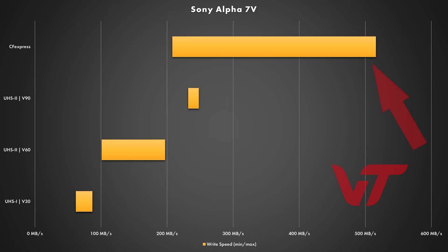The image buffer lasts really long with JPEG, but it can still get limited. We're definitely not talking about a limitation from the memory card controller. If you have really large image files — shooting at high ISO with a lot of noise and detail, stopping down your lens — we're limited to about 550 megabytes per second using CFexpress. You are limited by camera processing power: the BIONZ XR2 can't handle more images per second, and therefore the type of memory card you need differs a lot.